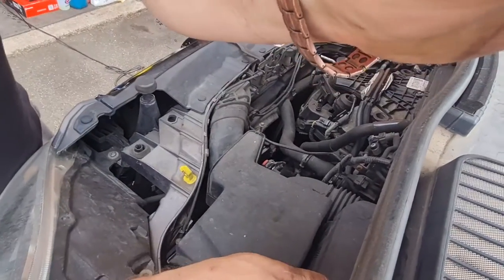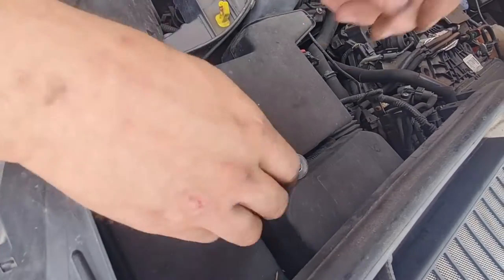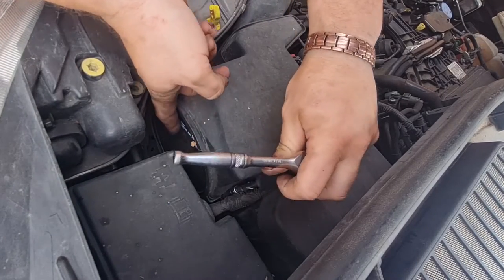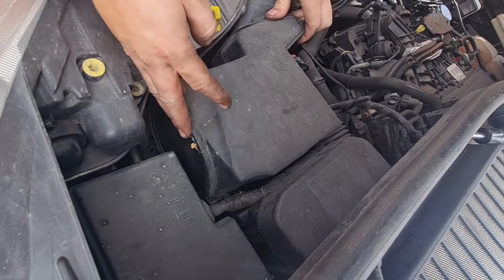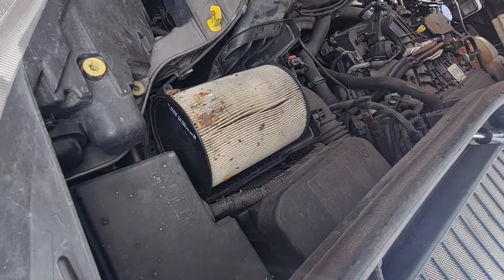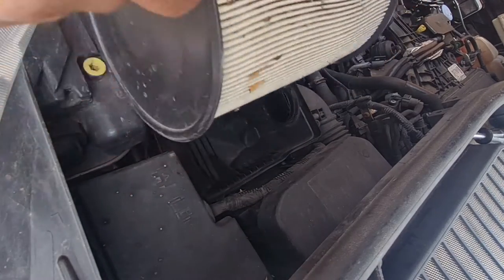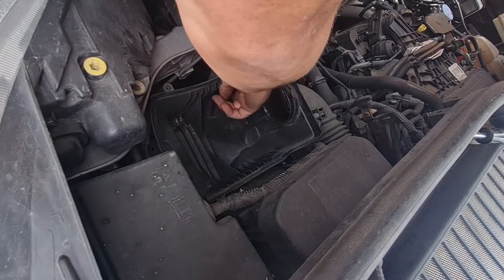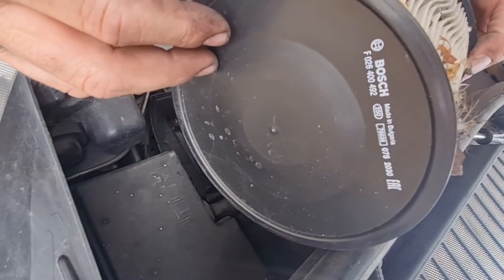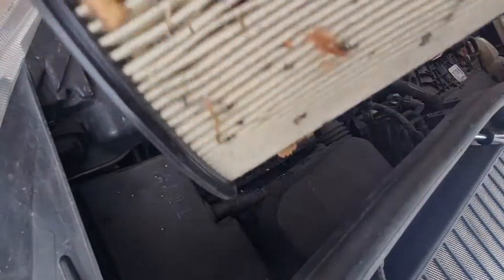Let's take the camera down a little bit. Bolt in each corner. Now the end of the filter you can actually see here — the cover doesn't cover the whole thing. This just lifts off. And there's your air filter — look at the state of that! That's a bit of a mess, isn't it? That just pops off the end of the box and out of the pipe. Make sure you haven't got too much debris in the bottom. I always usually go for Bosch stuff because it's quite nice quality. That is pretty manky — there's all sorts of gunk in there — good job we're changing it.